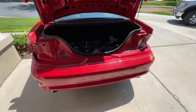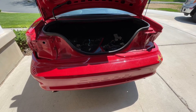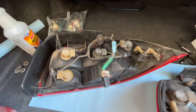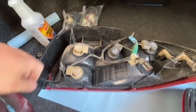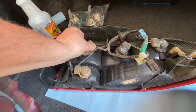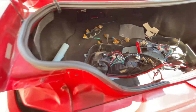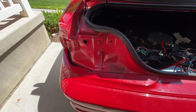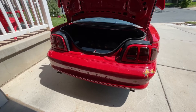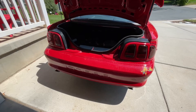Okay, now for some cleaning. Cleaning is done — I didn't go crazy just because this area of the car is going to get dirty right away, but it definitely looks better than it did. So now I'm ready to remove the harnesses and swap over the bulbs to the new harnesses and install the new harnesses. All the bulbs have been swapped over and the new harnesses are installed. Now what I'm going to do is put the taillights in place, hook them up, and then test them out before I button everything up. Both taillights are loosely in place, the harnesses have been reconnected — let's test everything out and see how we did.